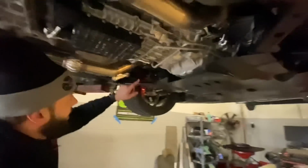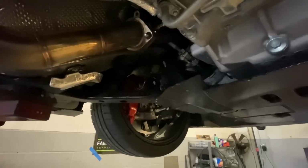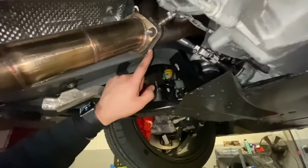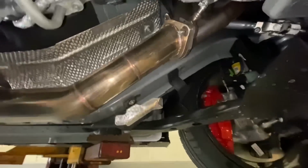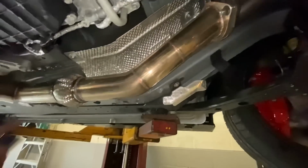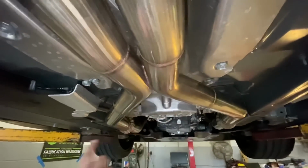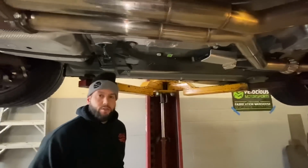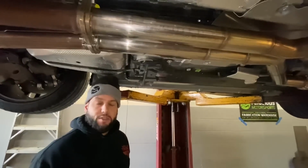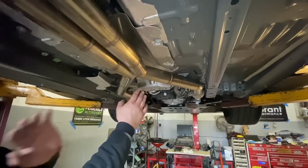We start out with half inch stainless steel flanges up at the manifolds because, you know, China makes 3/8 flanges, and they tend to flex. Most exhaust systems end up with a 3/8 flange that tends to flex and deform over time. This is a 1/2 inch stainless steel 304 flange, TIG welded, with some flex sections for engine movement, easy install, easy removal. We come back, we teardrop some 45s into an X-pipe so they continue the velocity while still equalizing sound pressures, because with a boosted application, exhaust scavenging isn't as necessary as just getting it out of here. So we just want to equalize sound pulses and get it out the back.